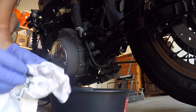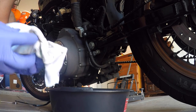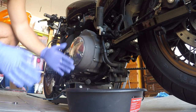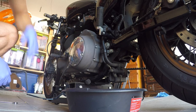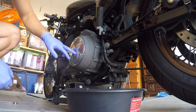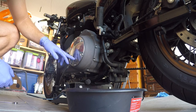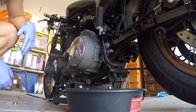Go ahead and let it drain a little more, basically until it's finished. It should only take about three to five minutes, depending on how warm you got it before you start draining. I have this on my jack stand to make it so the bike is straight up and down, not at an angle like on the kickstand, to get every last drop out. Plus when you insert the oil, there's a certain fill line and you won't be able to hit it if the bike is on its side on a kickstand.